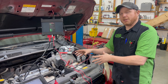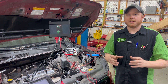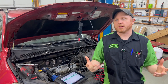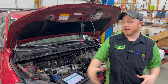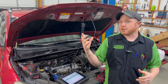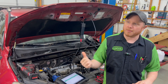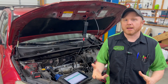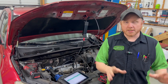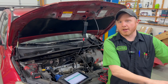I realize that this car we can get to everything really easy, but our scenario is that the stuff is hard to get to. So we're going to try to get to the fastest way to figure out what's wrong with it. When it comes to misfires, you want to use all of your senses, including common sense. If the thing's puffing out sweet-smelling white smoke, you can kind of assume you've got a head gasket issue. If it's puffing out white smoke that smells like fuel, you've probably got a stuck-open injector. If it's knocking or spitting back through the intake, you probably have mechanical issues.